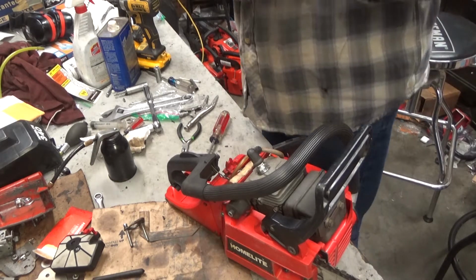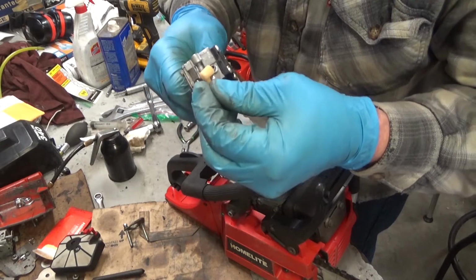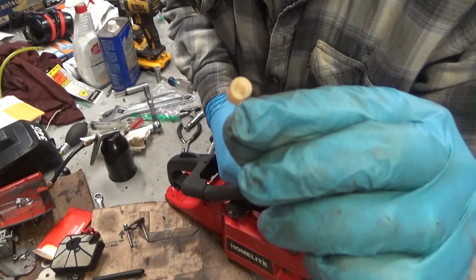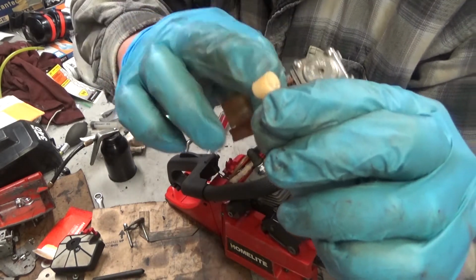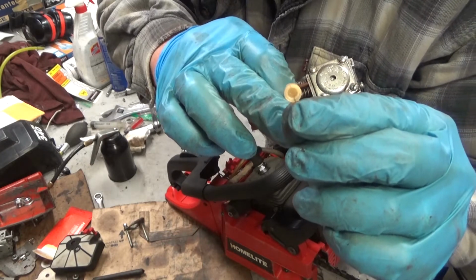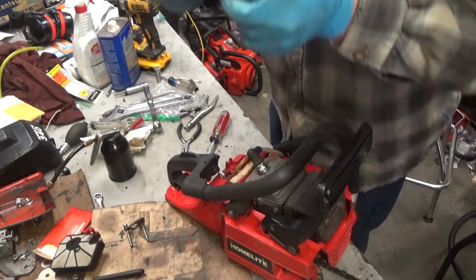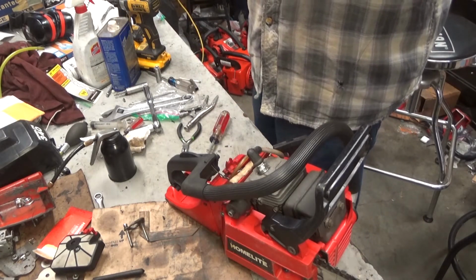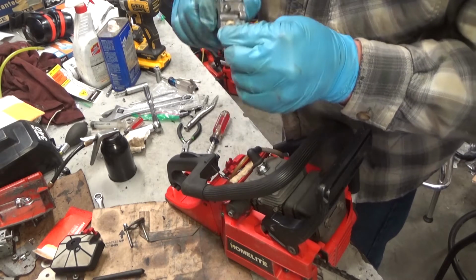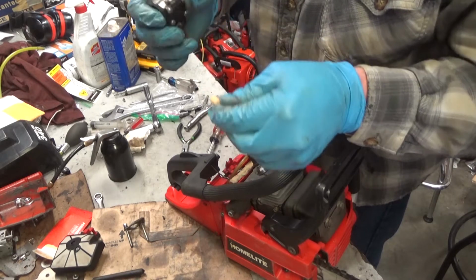Okay, so there's the fuel inlet barb. Look at that. It just fell off all the way. Alright, I can't tell on the viewfinder if it focused totally, but you can see cracks top and bottom. So it's sucking air. Pretty much once these things spin like that, you're in trouble. And when you see cracks running up the sides, you're pretty much toast.